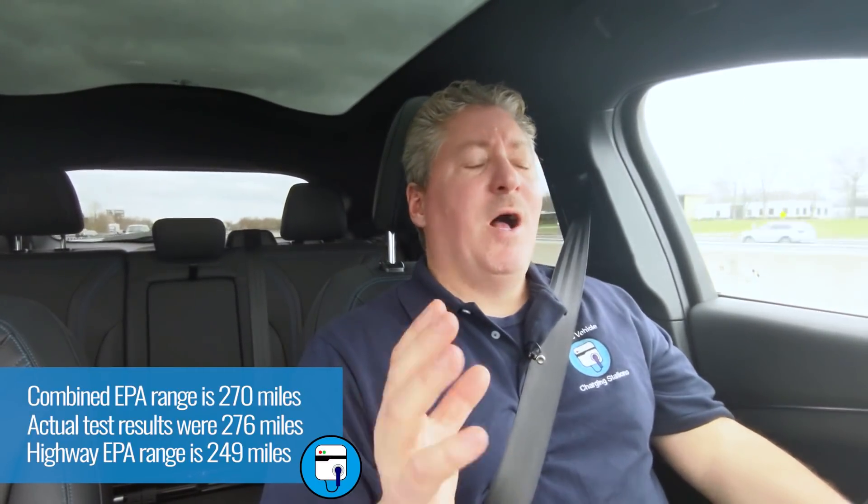We have the temperature, the wind, and tire pressure dialed in. We're going to check in at 50% of the way and see where we're at. This version of the Mach-E is the all-wheel drive extended pack with the 98 kilowatt hour battery pack. Of that, 88 kilowatt hours is usable. The combined EPA range rating is 270 miles per charge — it actually was 276, but Ford purposely derated it when they submitted their documents to the EPA. You're allowed to underestimate your mileage. So the city and highway combined was 276, but you'll see 270 listed on the window sticker.